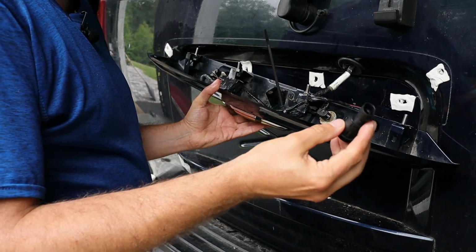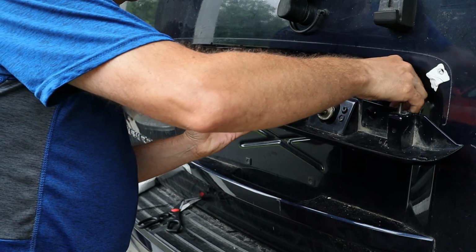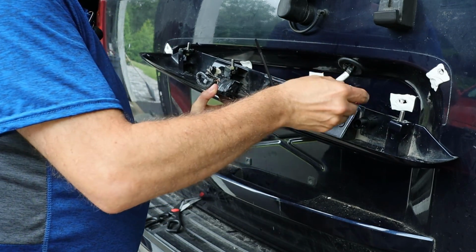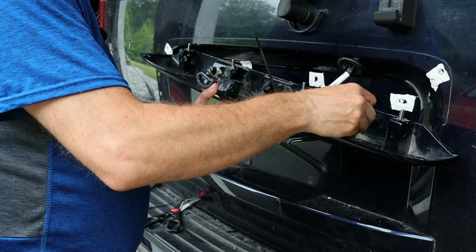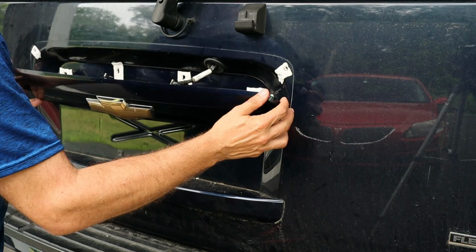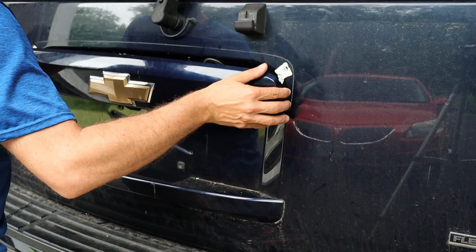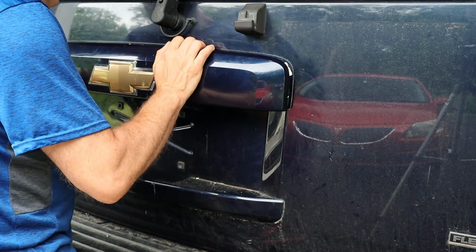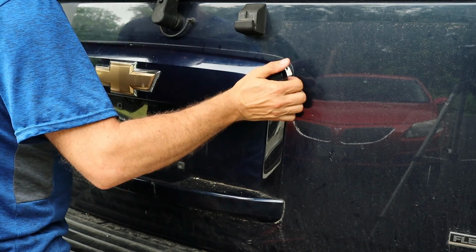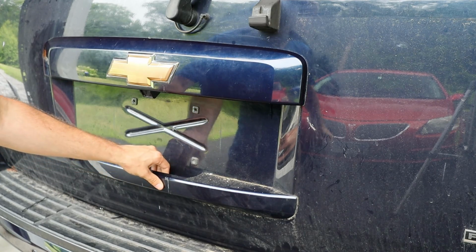And now I'll put in the hatch popper button, which was the whole point of going down this rat hole in the first place. This is just going to slide into the hole and click into place. And then I'll just reinstall the connector. And I can't forget my modified panel clips here over on the corners. Now I'm going to see if I can get all these bolts lined up to the holes in the gate and get this thing installed. I'll open this gate and see if we can put some nuts on those bolts and tighten this thing up.